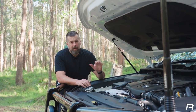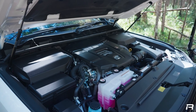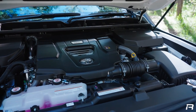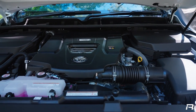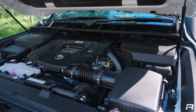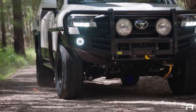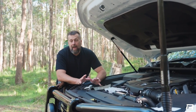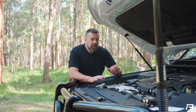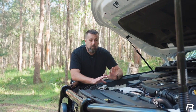Any good shoot, you've got to have a photo of the engine bay — everyone wants to know what's under the hood. Well, we're going to disappoint you here: this looks factory, because we haven't changed a lot under here. What we have done is throw the keys over to the boys at G&L. They put it on the dyno and tickled it up a little bit — the results came back at 330 horsepower at the wheels and just over 700 newton metres of torque. They've played with the auto tuning as well and this thing drives remarkably well. Our focus is drivability and longevity — these vehicles are built for touring. When you add weight, extend the wheelbase, and start towing, they can feel a bit docile. What we've achieved is a vehicle that's perky and really nice to drive without risking the engine or the longevity.